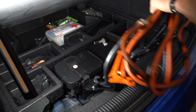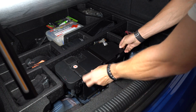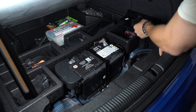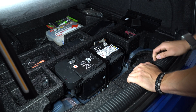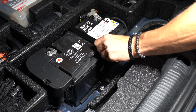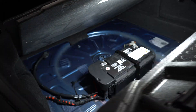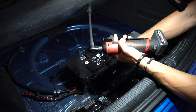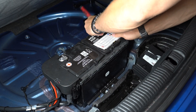The first thing you're going to need to do is clear some room and remove some of the clips to get them out of the way. Then you can access the bolts on either side and remove the bracket. Removing your Audi or Volkswagen battery is pretty straightforward — there's usually a metal brace that goes around the battery held in by two nuts and a bracket at the bottom that needs to be unscrewed. Then disconnect the negative and then the positive cables, and check to make sure if you have a vent tube — if you do, pull that out as well.